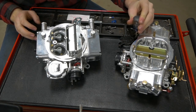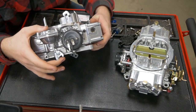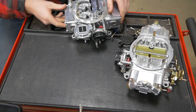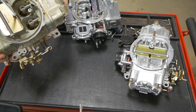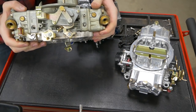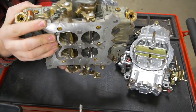You can get into a lot of science on that — Thunderhead 289 has a video on it. Now there are also mechanical secondaries where the diaphragm piece is replaced by a second linkage. Thankfully Thunderhead has a mechanical secondary carburetor here to demonstrate with. All these linkages are what actuate the secondaries and open them. You can see that as you drive normally it's just your primaries, but as you get into the throttle your secondaries open too.